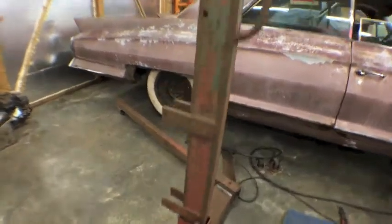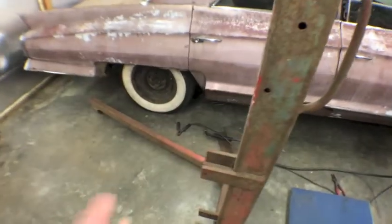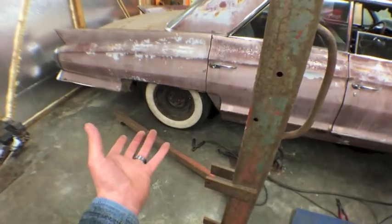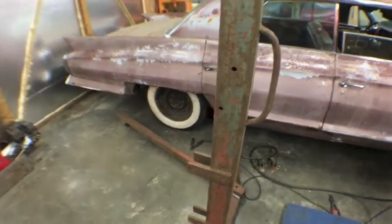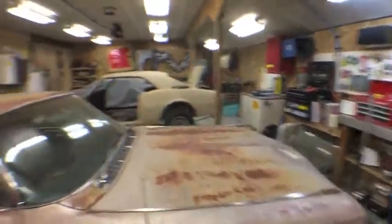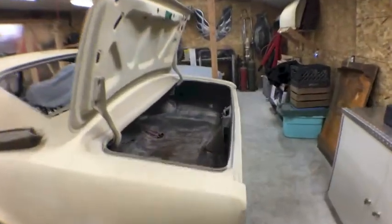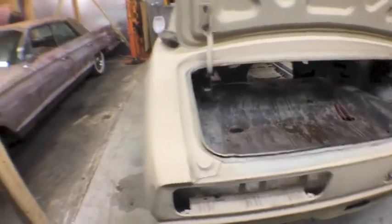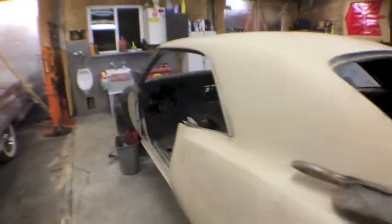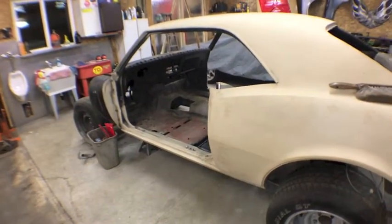Next step is to figure out how high off the ground I want it. The bracket that actually holds the car will hold it at whatever height, but I need to determine the height from the floor. This car is roughly six feet wide, so I'm going to need at least three feet plus however far off the ground I want the side panel to be. I'll probably bring it up a foot, so basically four feet off the floor — maybe a little more, just to be safe to clear the bracket assembly that'll be bolted to the car and then slide into the assembly on the rotisserie.